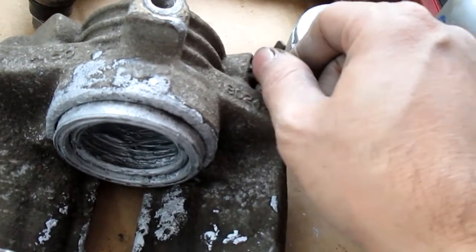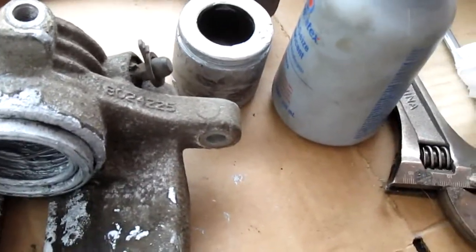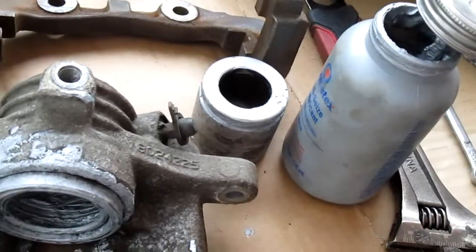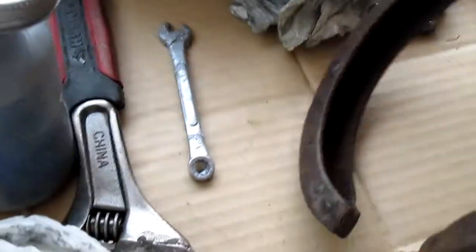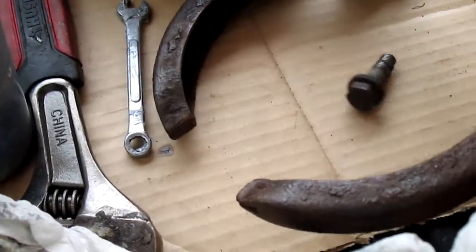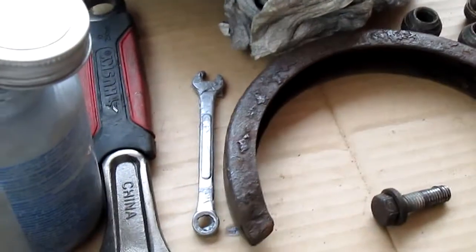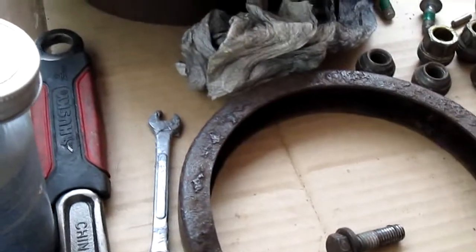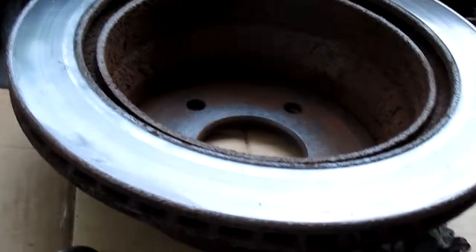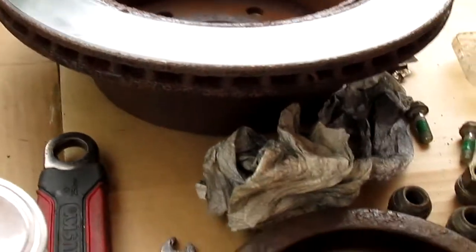I have to bleed the brake afterward. I even cleaned the emergency brake right here — those are the emergency brake shoes, I guess they call them. This is for the S10, a GM type setup. They make them like this and it goes into here and just rubs against here when it's pressed in. So it's important to grease this little section and make sure these pins will go in correctly.